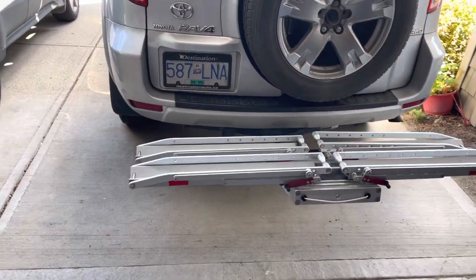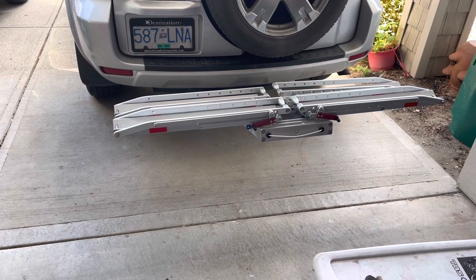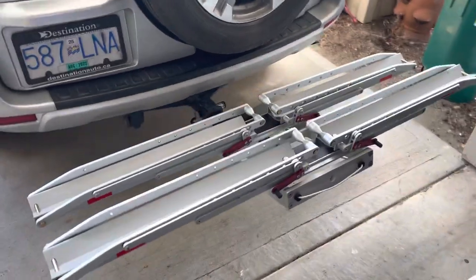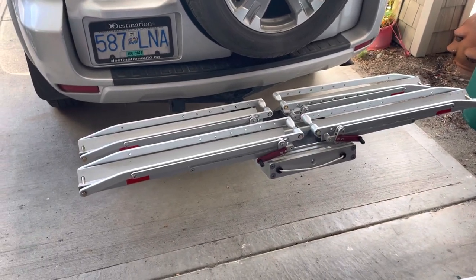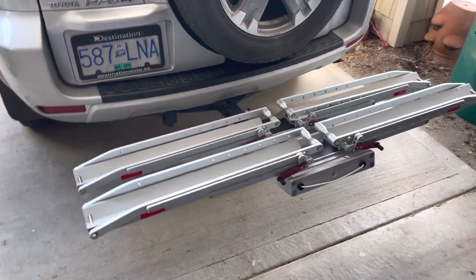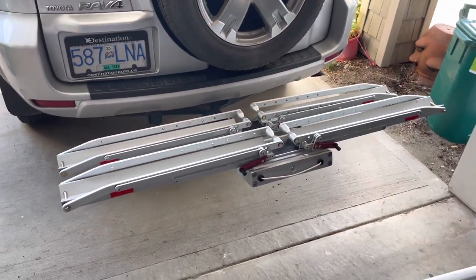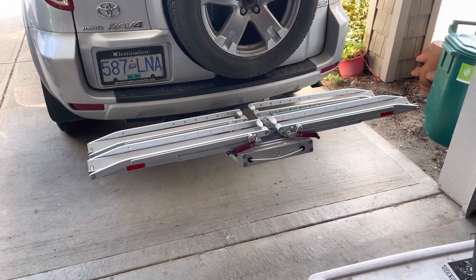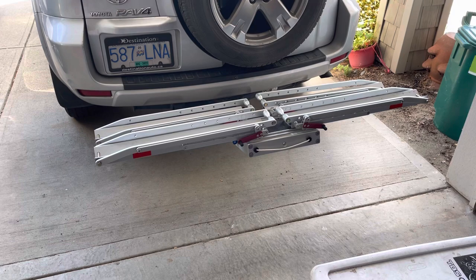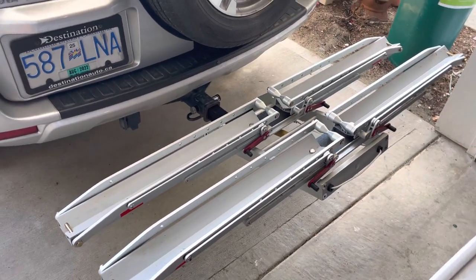It really comes down to: what type of hitch do you have? If you only have a one and a quarter inch hitch, the Quick Rack is your only option. If you have a two inch hitch, you could get either the Quick Rack or the Super Duty. Now, this isn't a single version — this is actually the dual version of the Super Duty. The dual version can be expanded from one to four bikes, and this exact one I have weighs 47 pounds with the two bike platforms. You can add two more expansion platforms at 50 pounds per bike, or if you only need three bikes, one add-on with 75 pounds per bike. So if you've got two e-bikes each around 75 pounds, this is really your only option.